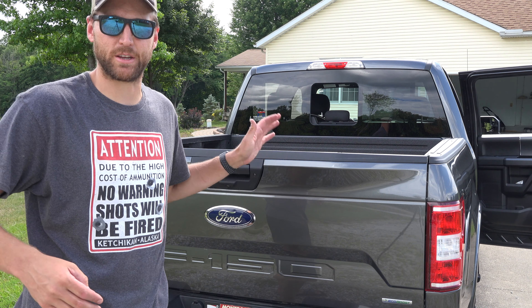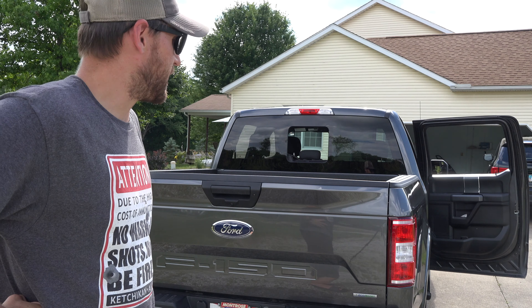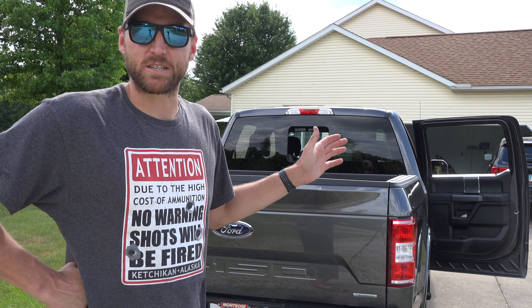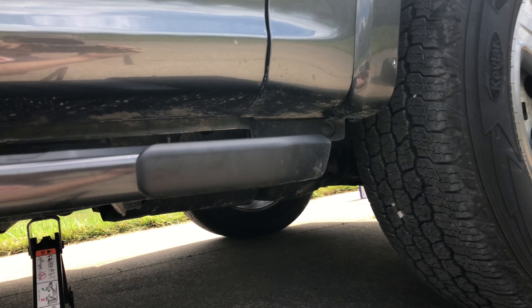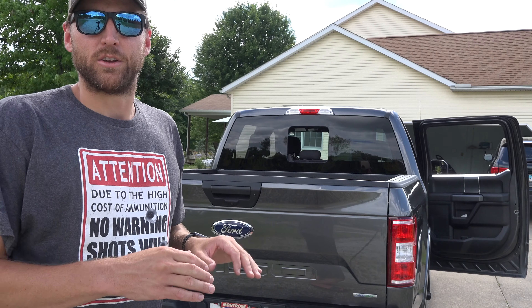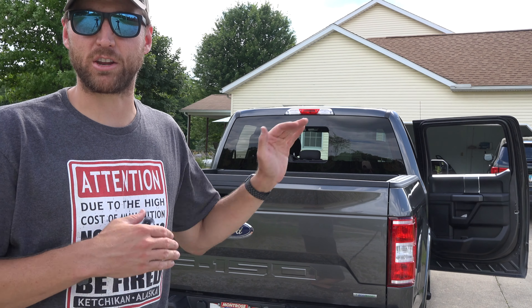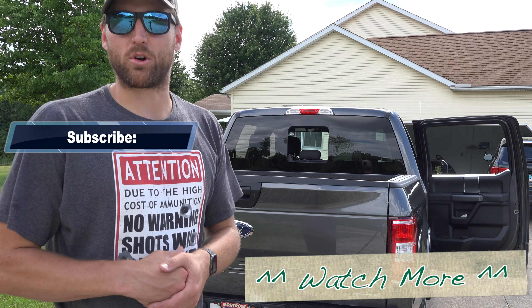Make sure you also engage your parking brake. When jacking up the back end, you'll need the full length of the rod because the jack sits so far under — that's why the rod is so long. On the front, the lift point is on the frame just behind the tire, similar to most cars, just a little further under. I have an arrow pointing to that lift point — stick the jack in perpendicular and jack it up.